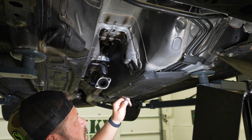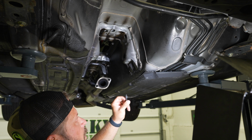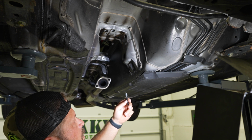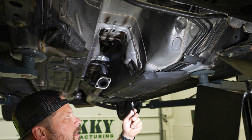And this is a really cheap little spot weld drill. You can get them on Amazon, your parts store, but this is a 3/8 version. And you can even flip this hole saw around and get new cutting edges if you wear it out. So you should usually be able to get all the way through this whole cross member with one tool, but we'll count the spot welds and see how it works.